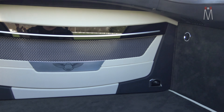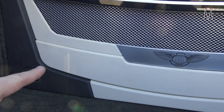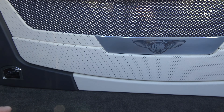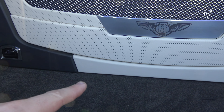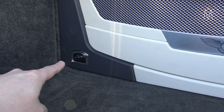We used a lot of factory materials. You can see we have the cream color linen vinyl and then the perforated version in the center creating the insert look. These are all different thicknesses from top to bottom — cream solid in the center and matching black on the sides. We incorporated the factory tie-downs into the panel we built. The subwoofer enclosure is bolted to where those were on the side, mounting it in a sturdy way in an OEM location — no new holes drilled.